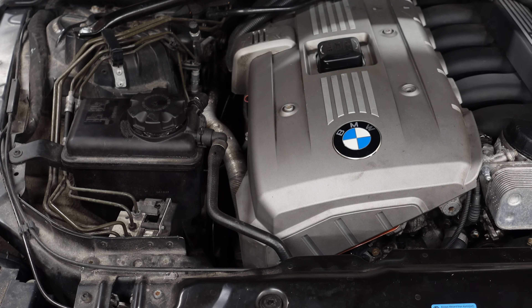A lot of you will ask why I'm not doing the water pump and thermostat. If you remember from a previous video, this water pump was only changed in 2014, so I'm still undecided on whether to change it. I'm not going to be putting new coolant in this car at all until it's fully finished — same goes for the oil. I want all fluids to be fresh when it first fires up. Now let's drain the coolant — I'll get it up on the lift and show you how to drain it.